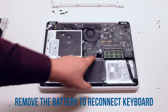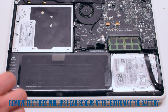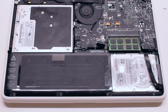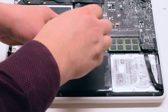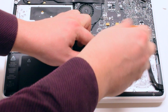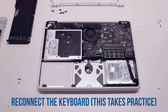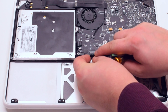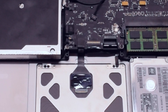We have to remove the battery to reconnect the keyboard. Battery removal. Start off by removing the three Phillips head screws at the bottom of the battery. Now remove the three tri-wing screws at the top — the one on the far left is hidden behind a piece of tape. Pull up on the battery and remove it. Now that the battery has been removed, we have access to reconnect the keyboard. This is a difficult task and might take some practice. Make sure the eyelash is lifted up before you attempt tucking in the keyboard. Once tucked in, press down on the eyelash.